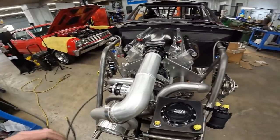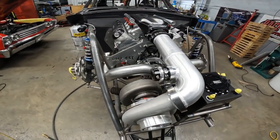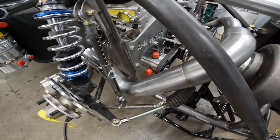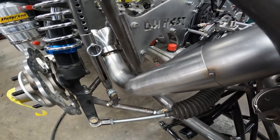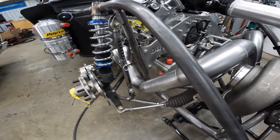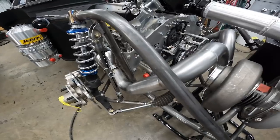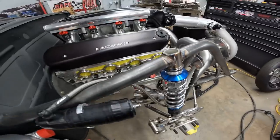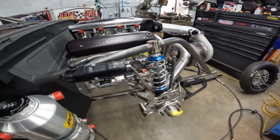I've been on a pretty good roll this morning and just worked through lunch - it's about mid-afternoon now. I'm going to go to lunch because the hot side's mocked up. You can see we went through the control arms there. It's back up on the Projax now because I had it on the crib blocks and already tested all the clearance and stuff. Taking the wheels off and stuff made it a lot easier for me to hold all this stuff and get it tacked in.